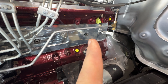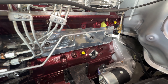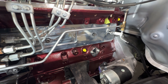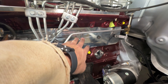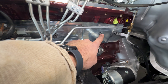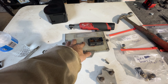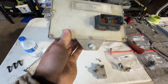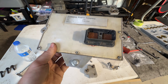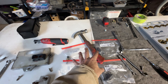Alright, as you can see we have one, two, three — all bolted up, ready to go. Those are tight. And then we just got to get bolts to go in those. That's the idea of the Keening billet tappet cover and how it's recessed to allow room for the spacers to thread in. So now the next idea is to go ahead and slap this ECM on. I got one bolt for it right now, so this is going to hold it for now. I got to get two other matching ones, but we're going to put that on and then start jumping into all the sensors.